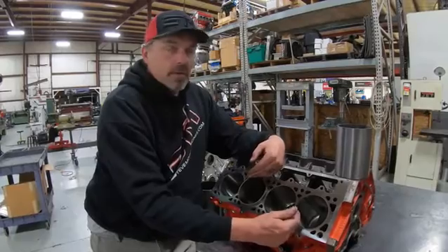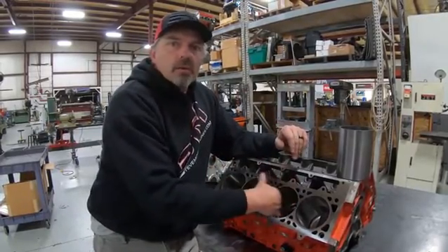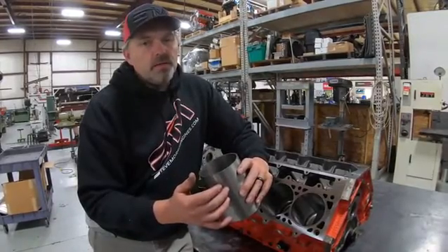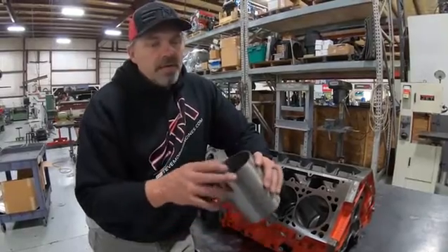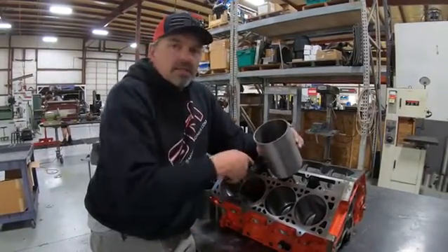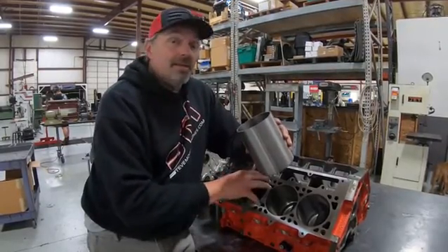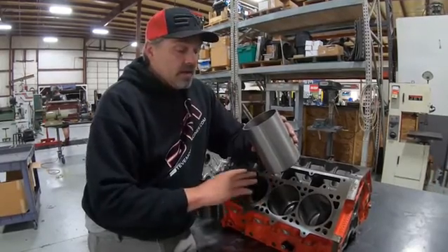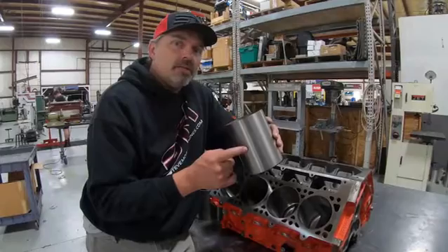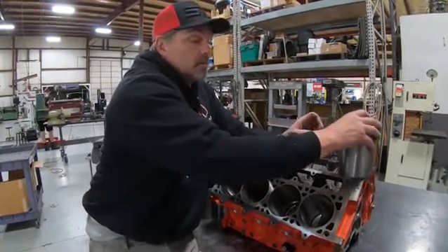So that's the general repair sleeve — straight, no step, just fixing a crack and sealing it from behind. The thing about an eighth-inch wall sleeve is that in big horsepower stuff — a thousand horsepower and below it really doesn't matter — but above that it will give up the ghost. I'm never going to sell this block for anything more than 1,500 horsepower because there's a crack behind the sleeve. In fact, this one was already sold to a customer who leaned on it hard and cracked the sleeve because there was no support from behind. That gives you an idea of how thick cylinder walls need to be — an eighth inch, 0.125-inch wall, is not thick enough.